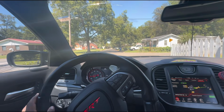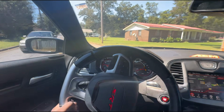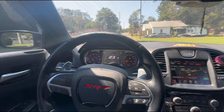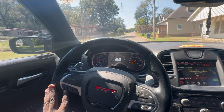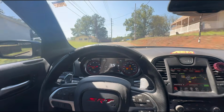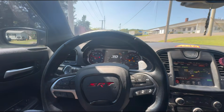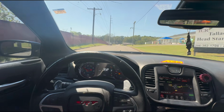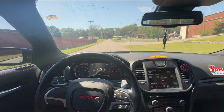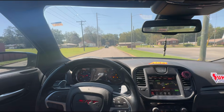What I was saying? Really, them bolts is not the same. So if any of y'all support me or want to learn about a swap in general, I can tell you for a fact, going from a V6 to a V8, make sure you get the actual donor car. Everything you think you may need, just grab it. The parts I used were the motor, obviously, the trans, the drive shaft, and I had to go buy an engine harness.